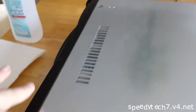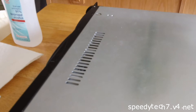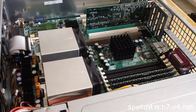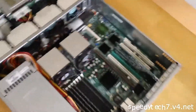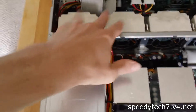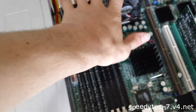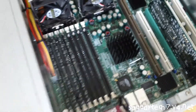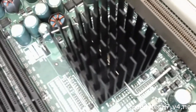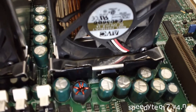Push these down and pull out — there's two on each side. Push them and pull off. Alright, I'm back with the top off of the server. It's got these four 80mm fans, two 60mm fans for the processors which are not too hot right now, and one passive heat radiator for the north bridge, held down by retention clips — same as the CPU sockets I'll be detaching in a second.